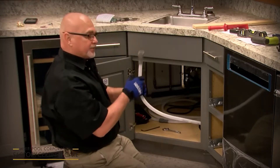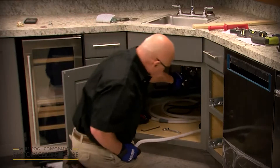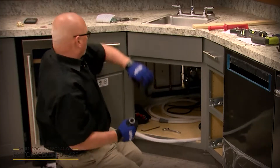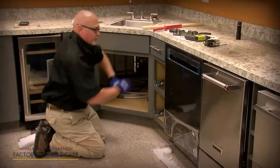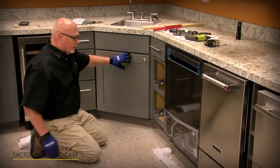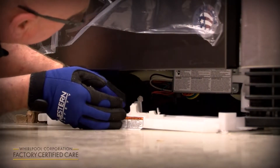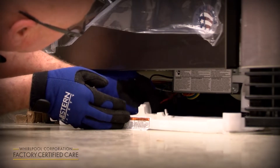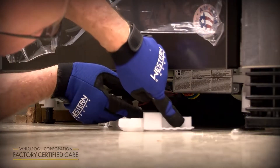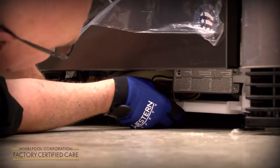The drain hose has two different dimensions: the larger end is for a garbage disposal, and if you've got a P-trap port it's a smaller diameter — cut the hose here to fit the smaller diameter. You can use a hose clamp, or for a disposal use the red clamp. Under the sink, plug in the power cord, turn on the water supply, and connect the drain hose. Then plug in the drip pan float assembly — that orange wire connector just plugs into the back. Once plugged in, it'll stop beeping.